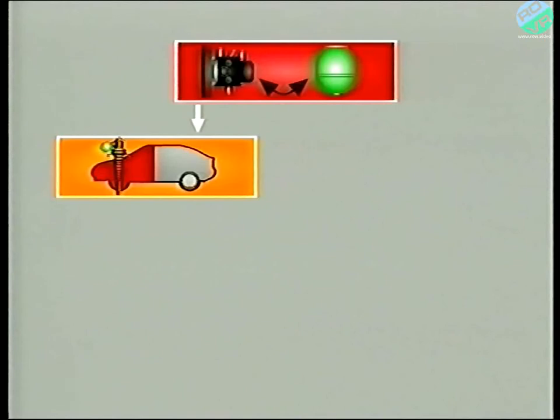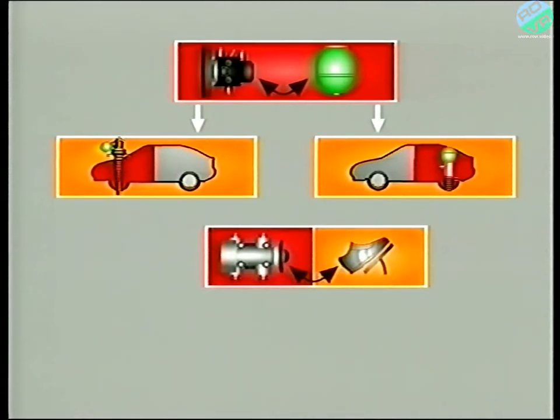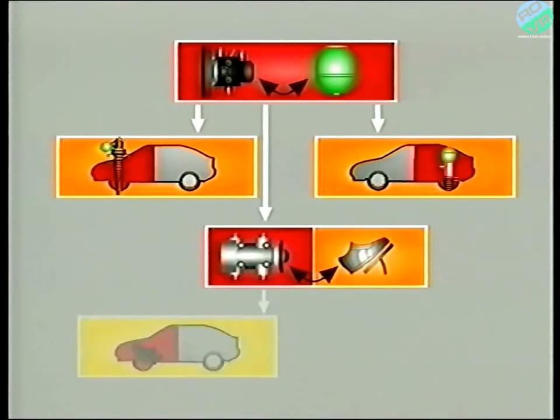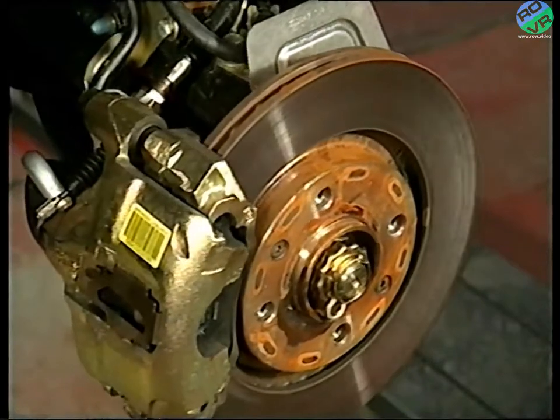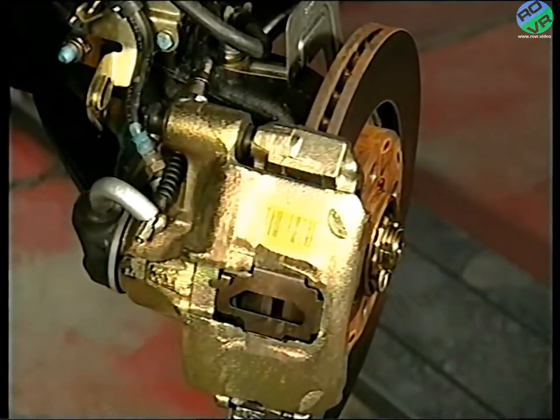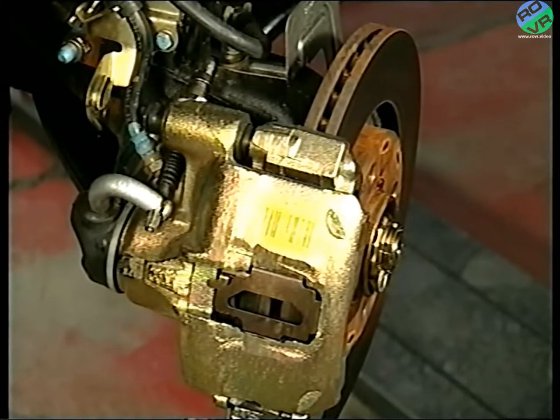Here's another way of looking at the system. Our source and reserve of pressure directly feeds the front and rear suspension. The brake control valve has two circuits — it receives system pressure from our source and reserve and makes this available for the front brakes, and its other half receives pressure from the rear suspension to supply the rear brakes. Note that the hand brake works on the front wheels. The hand brake cables connect to the front brake calipers and the linkages push the pistons and the brake pads against the front discs.